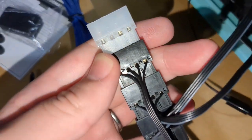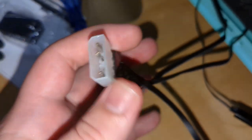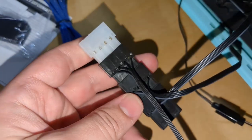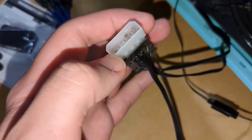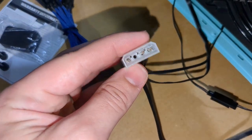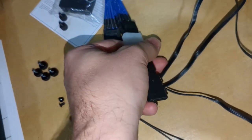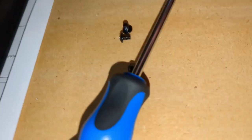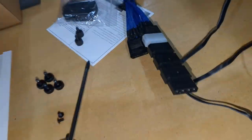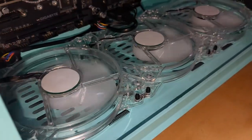To illustrate what I'm talking about, I've put the third pin back in — it's numbered pin 4 — the 5-volt pin, which is the 5-volt line on molex. That's how the LEDs are powered and I think the color data goes down that line as well, to communicate with the other fans from the main controller fan. So let me plug this in. The fans weirdly are already starting without turning on the system — not sure how that's functioning.